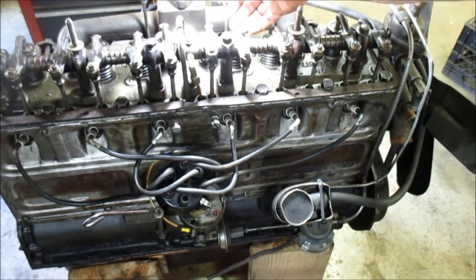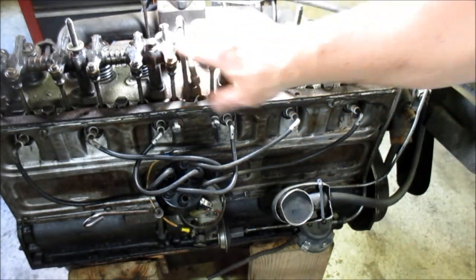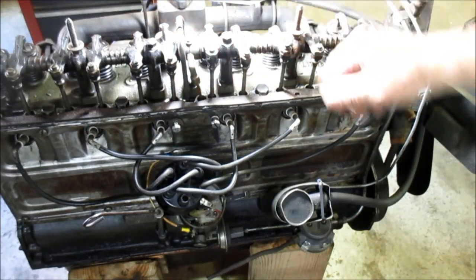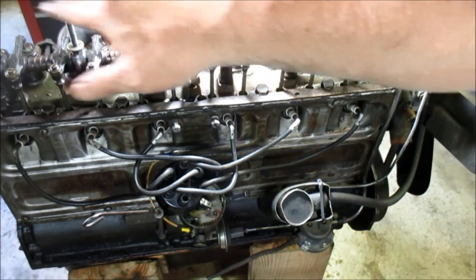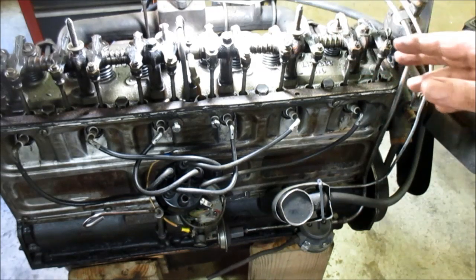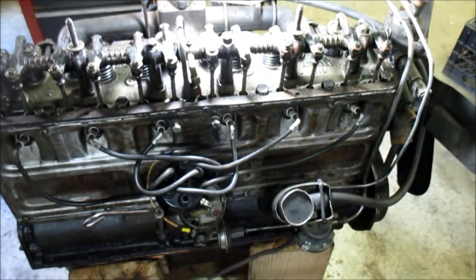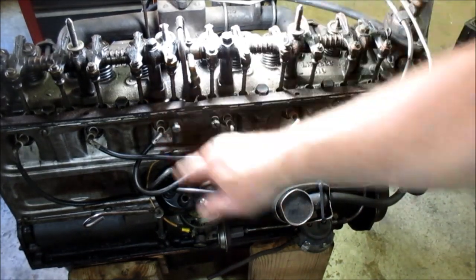It gets around on the tips here. It gets in the socket here for the adjustments. So splashing oil lubricates from the rocker arms going back and forth the rest of the rocker arms up here, the valve train. Now, even though this is a low pressure engine, there is some oil pressure up here, with the splashing. And I've had, since day one of this, a problem keeping this valve cover from leaking.